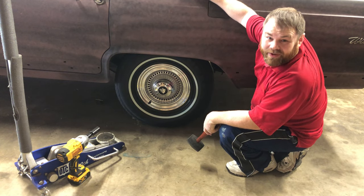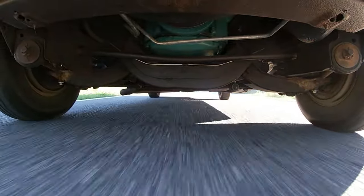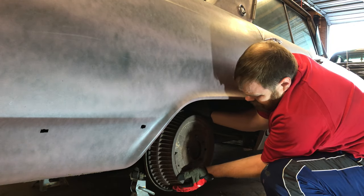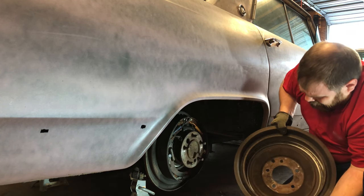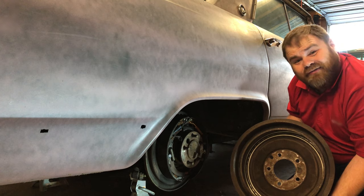It's time to put the car through its paces. My test drive was good, but I've got a grinding noise out of the passenger rear. I want to take this drum off. Everything looks fine as far as springs, but — see that line on the inside of the drum? That shouldn't be there. That means the shoes are rubbing. So let's figure out how we're going to fix it.